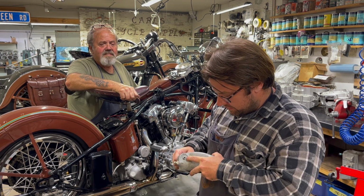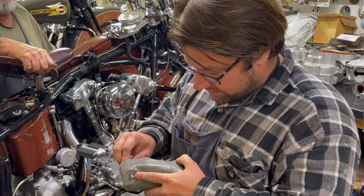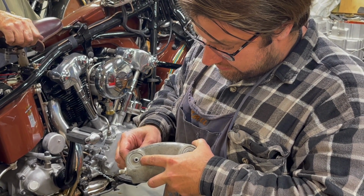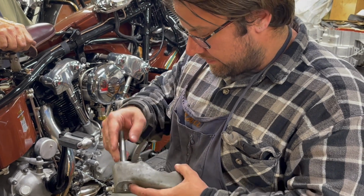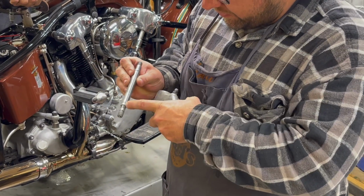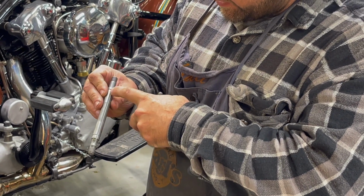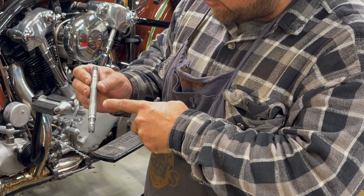They would hit the rocker box with a punch, and then each and every shaft has a line that's staked in it. So if these two would have come together, that's where the rocker arm would have been set for optimal oiling. And you can see on these early shafts, they have a groove that goes all the way through, and the oil comes through here, and then gets in this groove, and then goes out the rocker arm, and that's how your valve spring and valve guide are oiled.